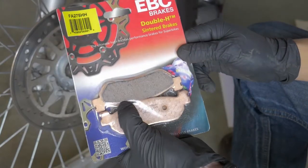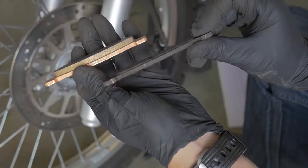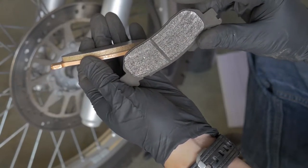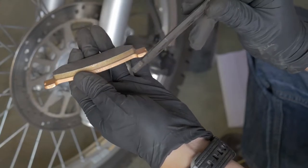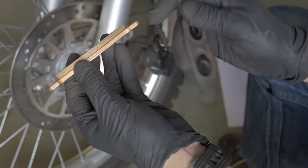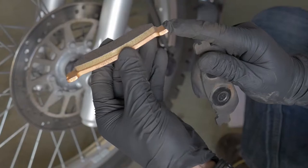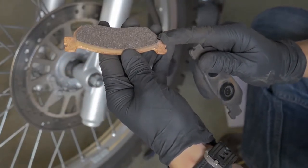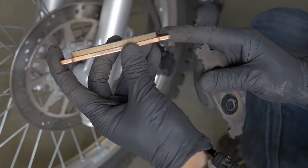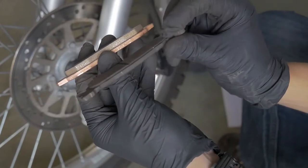There's not a ton of life left on these pads, so I'm glad I'm changing them when I did — this is kind of an irresponsible level to get them to, but it's better late than never. Here's a brand new brake pad next to the one I've been running — there's almost no meat left on the old one. As your brake rotor passes through and you're applying the brakes, there's not a lot of material to transfer and dissipate heat onto a worn brake pad. That's why it's really important to have new brake pads with a ton of meat on them, because the more material you have, the more efficient the brake is at dissipating extra heat.